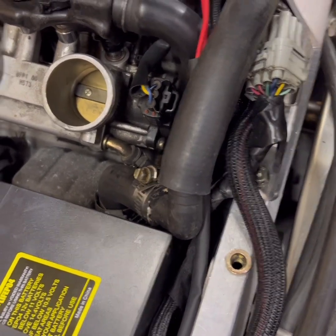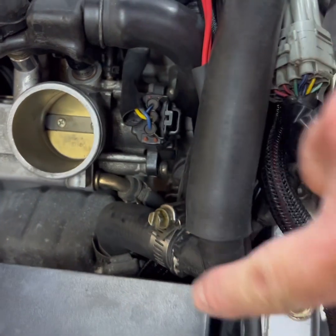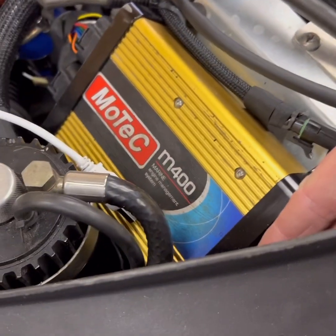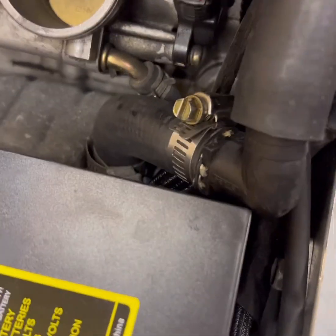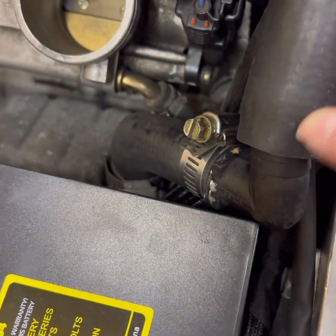So what's my plan? For years I've been ventilating the crank with the factory case evac, which is right here — there's a baffle here and then it comes out. I've just been going to a little filter and it's kind of sitting up here, just blowing oil mist everywhere, which is kind of annoying. So this year I'm going to run it up through here.